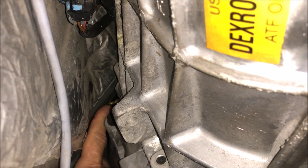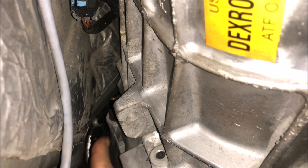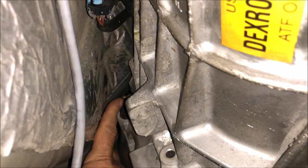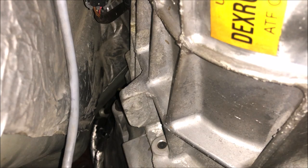You're going to have to constantly go back and look at that master cylinder up in the engine compartment to make sure you're not emptying it, because it's so small. Out of concern for how many clutch pushes you do and how much fluid you drain, you might run the slave cylinder dry, so you have to be very cautious. The benefit of watching my channel is that I do all the testing and figure out the solution so you don't have to.